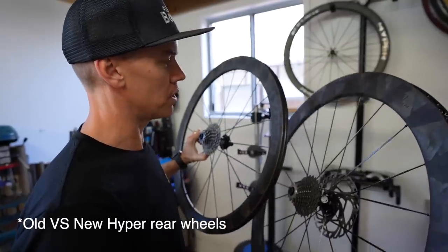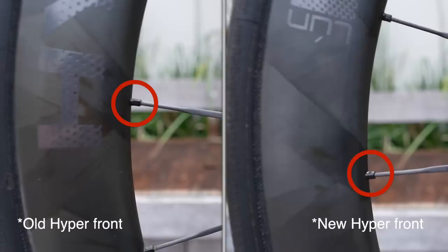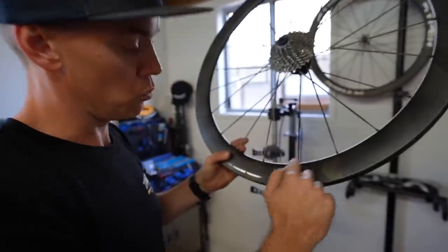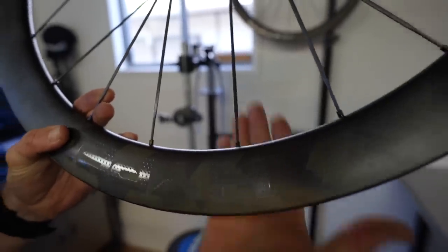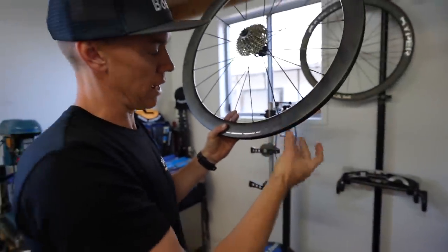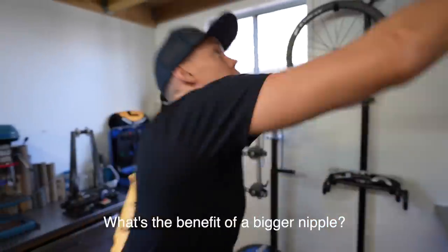In regards to nipples, when you look at the nipples and how they connect to the rim, the Winspace runs a shallower nipple section — I just put a vernier on it. If you have a longer or normal nipple, like what you've got on the ICANs, you have an aerodynamic disadvantage — anything protruding here means you haven't got that aerofoil working for you. That's an ICAN — conventional nipple.